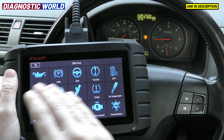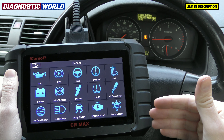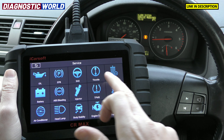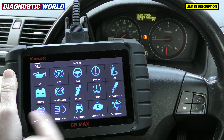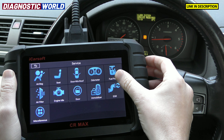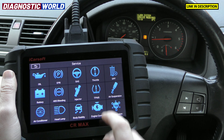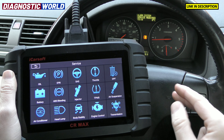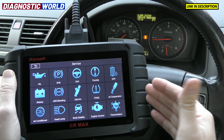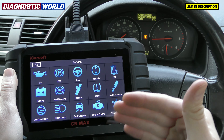This is really what your garages would generally have access to. Sometimes these cars need special things done to them over and above basic code reading and fault scanning — things like service resets, opening and closing calipers, steering angle sensors, throttle calibrations, DPF regenerations, battery registrations. You can see this tool does a lot more. Scrolling through, these are the kind of service or special functions you can expect. That doesn't mean all of these will be available for your specific vehicle — for example, if you're diagnosing a petrol car, DPF regeneration will be no use to you.